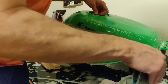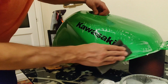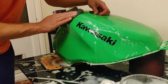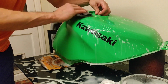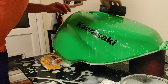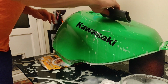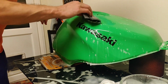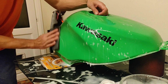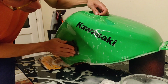You can hear it every so often. It gets a bit louder as you find bits that you may have missed with the 1200, particularly on the edges, because I'm being very light on the edges. It's really very easy indeed to burn through your lacquer and your paint if you're going hell for leather, particularly on edges like around the fuel cap. I've given those a bit of a wide berth, I just have to compound them with a bit more venom later. Make sure it's nice and even. There we go. I'll fast forward you and drop you back in once I'm done on the 2000 grit.